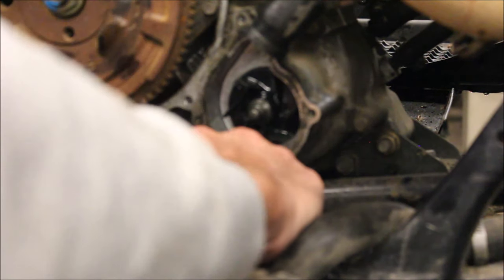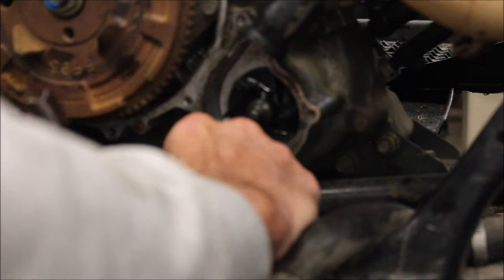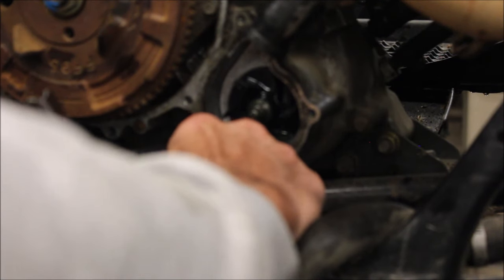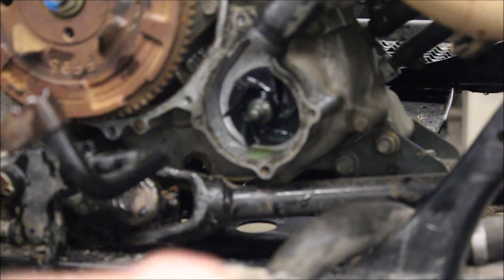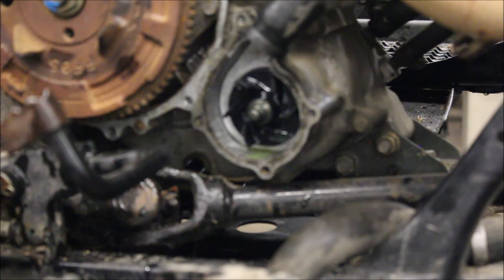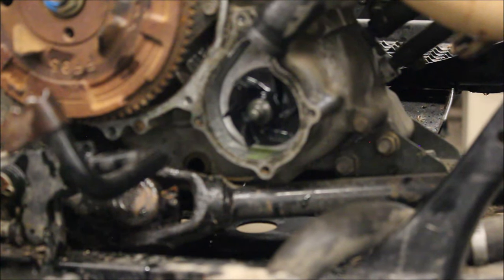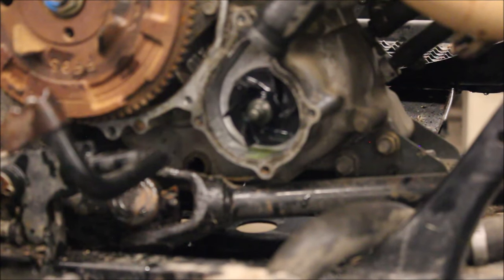You take a 14 millimeter wrench and there's a bolt on the side of the case here. I already loosened it so I'll get my hands in there — I got long fingers so that helps. Try not to drop the bolt. Put that in my container, oil down below. The oil is really dark — that oil hasn't been changed in a while. I do not smell coolant, which is a good sign. Usually if there was coolant in there it would be milky white. I guess that's a good sign.